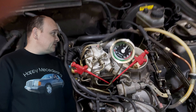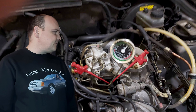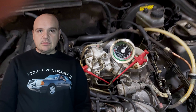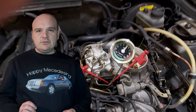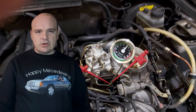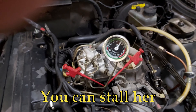My pressure is within the specs — it reads 5.1 bar at the lower chamber. Now we're going to stall the engine. The pressure must drop to 2.5 bar and remain at 2.5 bar for half an hour — that's our residual pressure. Let's see what happens.